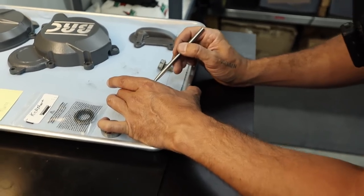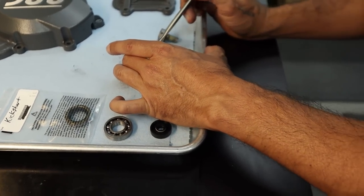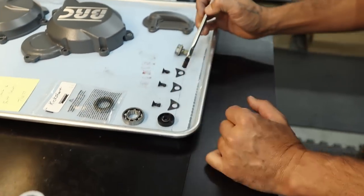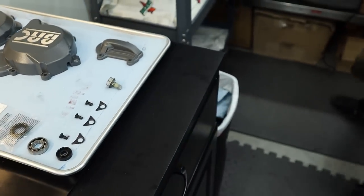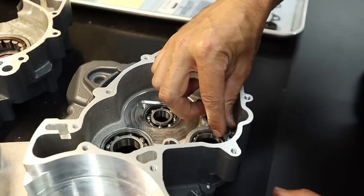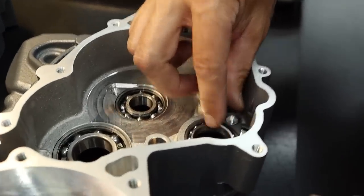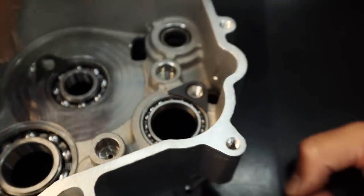Right now I am doing some grease, just a little bit, on those countersinks, because when they meet these surfaces, I want it to be able to slide, not grab. That was a little bit of assembly grease, then the thread locker. You said you want that to slide when it hits the plate, that countersink and that plate, to get a good torque. Okay, that's pretty cool.